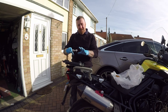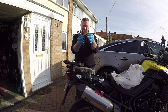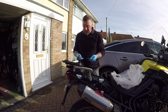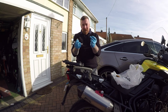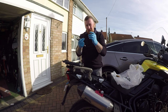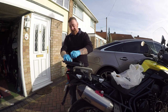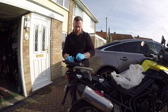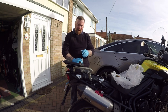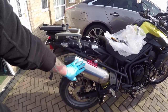Had to drill four holes in the plastic — that fitted nicely on. Had to elongate them slightly because you were just using your fingers to where they were. And I was right: these four bolts here were for the side and the bottom, which I already had on, so they can go. These four I have no idea — there's nowhere for them to go, so they're not going on. Spacers again I don't know; the two nuts I'm assuming possibly would have gone where they go through, and that's possibly what the spacers were for. Nicely on. Now what I've got to do is just screw these down. Now this plate moves — all the Triumphs seem to have this moving mechanism, ready for wind so it doesn't pull on the bike. I had a 2016 model. Video coming up on how that sounds.